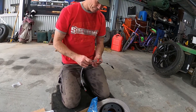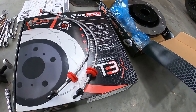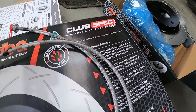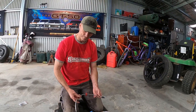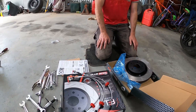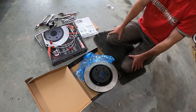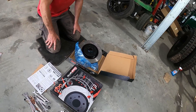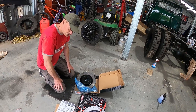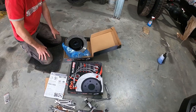Barry Smith from the V8 racing series has made us up some nice lines - these are the same as used in the ute series when they were actually racing. These should be a vast improvement on the factory line and give us a better pedal feel. The other good thing is we'll have a different feeling on the pedal - it won't be like those rubber lines that expand when they get heat and go a bit spongy with long pedal travel. This should be an improvement.